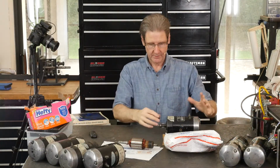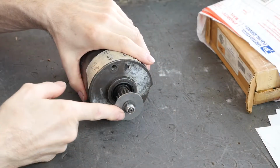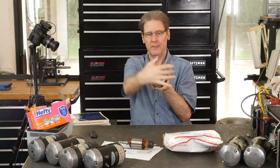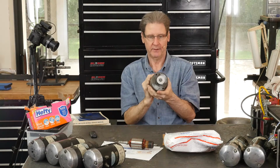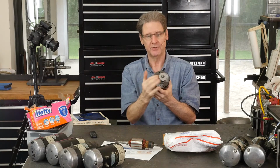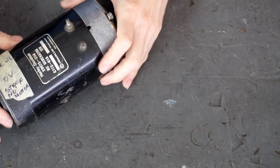All right, we got the generator, the gear, and the oil slinger put back on. Can you see it? This is what's a little tricky. When you take it out of the bike, you take the 2 bolts off of the gear case cover on this side, and it'll flop down a little, but it won't come out. You got to go way down and get this oil slinger big washer up and over the gear that's driving this gear, and then you can get it out and in your hands.